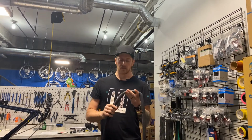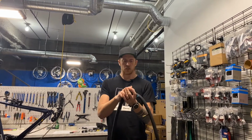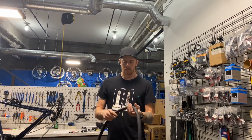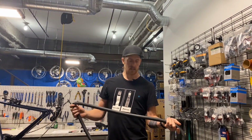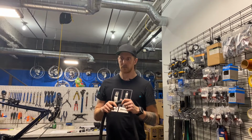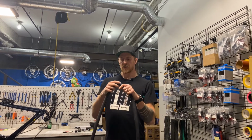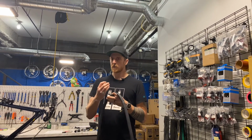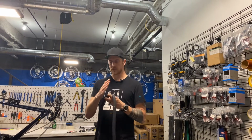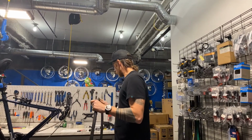Another kind of hole that you can see will look like a brush burn or an abrasion, and sometimes that can even be all over the tube. If you pull your tube out and there's tube crumble all over it, like black dust, that's a sign that you've probably been riding your bike around with way too low of pressure for a long time, and your tube is literally disintegrating inside that tire. If it's just in a small area, it could be a rough spot in the tire that's rubbing up against the tube as you're riding. So just some things to look out for.